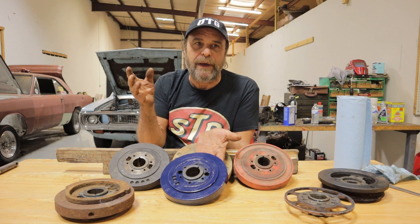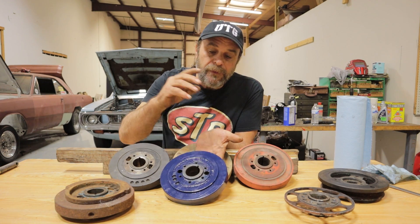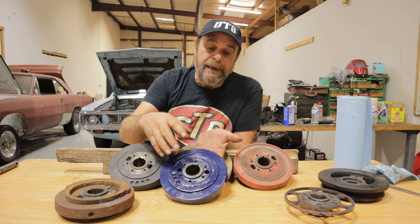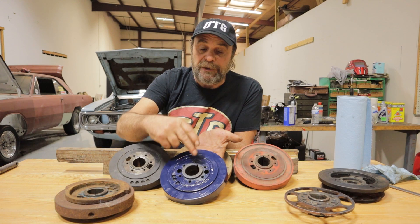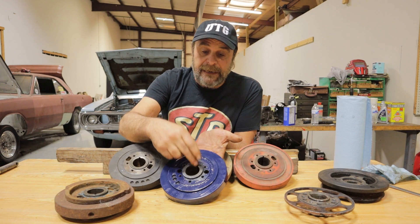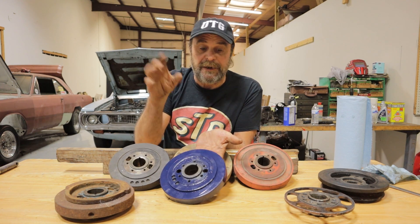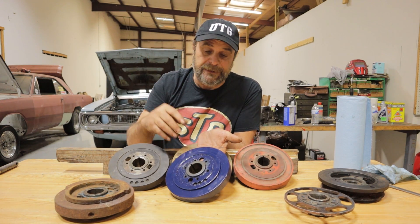If the inertia ring has slipped, throw it away and start over — or get yourself a nice aftermarket damper. They're not cheap, but they work well. A fluid-type aftermarket damper goes a long way toward increasing engine life. If you've confirmed your damper is in good shape — the rubber looks good — check that it's indexed correctly: with the damper on the crank, the keyway positioned so that number one cylinder is at top dead center, make sure your timing mark lines up with the timing tab on the front of your engine.